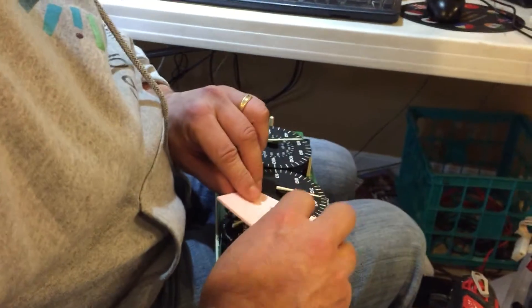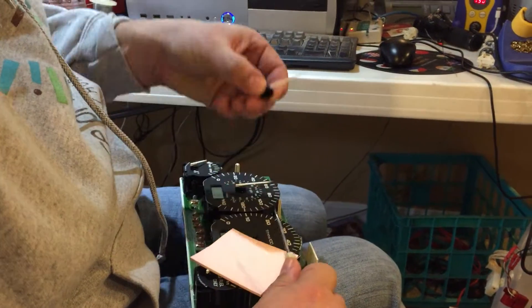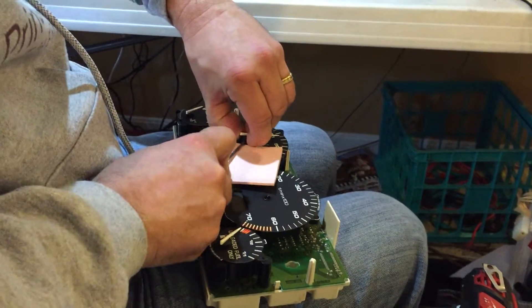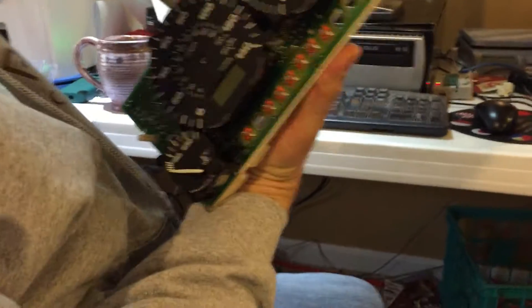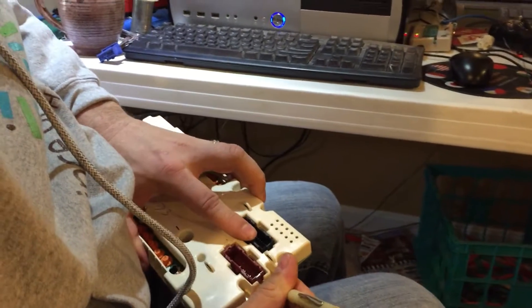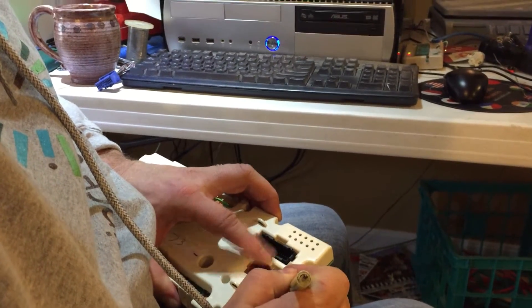It's a little tricky to take the needles off — you have to pry them off. Put something underneath your screwdriver to protect the gauge, and then you just pull those off. Sometimes they're a little tricky, sometimes they come off pretty easy. If you don't put that little piece of paper under there, you'll scratch the surface, so you don't want to do that. Once you have those off, you simply take this back piece off — it comes off pretty easy. There's a little tab you push in over here, and the black cover will pop right off.